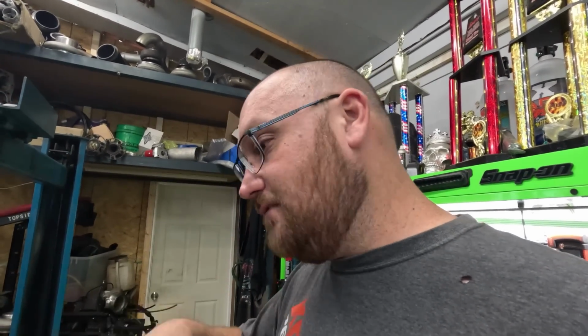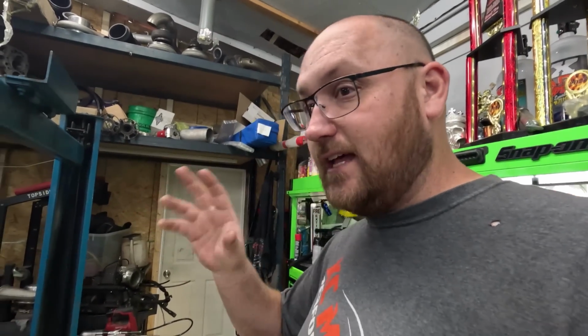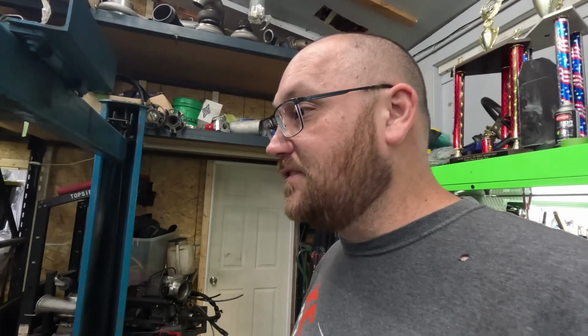So we put new springs on the car, even though they only had like 25 runs, most of that dyno pulls, and then 2 track runs and a burnout behind the shop. And then shims and different retainers and new keepers, to get everything set to where we can have that new installed height. Already the car sounds crisper. It sounds, or it needs fuel. It's showing it's a little lean.